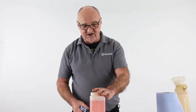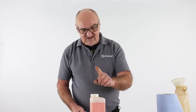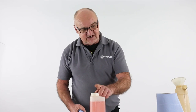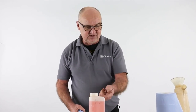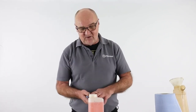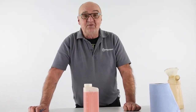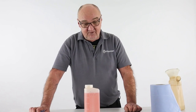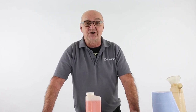So there we are — a simple little procedure. If you're going to make an error at all, a little bit too much oil rather than too little is always the way to go. But not by large quantities, or you'll end up with quite a smoky engine when it's running. That 40 to 1 mix is perfect, and that's how it's done. I do hope you found this demonstration useful. For more information on this or any of our products, visit www.hyundaipowerproducts.co.uk. I've been Adrian — thank you for watching.